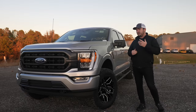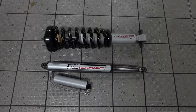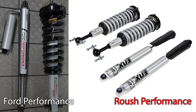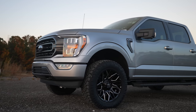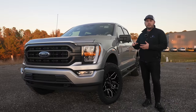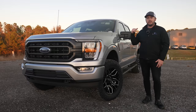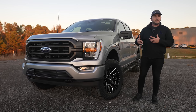Let's go ahead and look at the differences between these two lift kits. This lift kit that Ford Performance did is very similar in that it is a two-inch leveling kit, just like the Roush kit that they partner with Fox on. Up front you're going to get two to two and a half inches of lift while retaining the same height in the rear. Both kits come with full coilover replacements up front and new shocks in the rear as well.